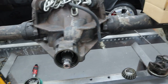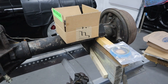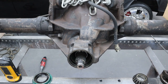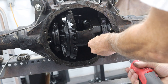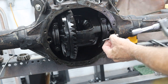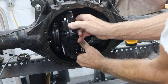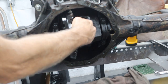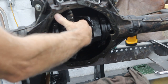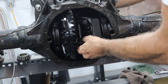For now we're going to go ahead and get the stuff stripped off the ends — get the drums, the backing plates, all that stuff off, and get the axles out so we can start cleaning this thing up and get it ready for paint. Eventually we'll get the ring and pinion back in and get it preloaded, and then we should be ready to start reassembling some nice parts. This is a C-clip rear end. We'll push the axle in, the C-clip falls right off, and then pull the axles out — making sure to keep them in the right orientation so I don't mix them up. Slide it back in so the spider gears don't fall out.